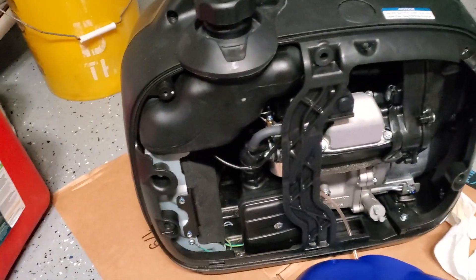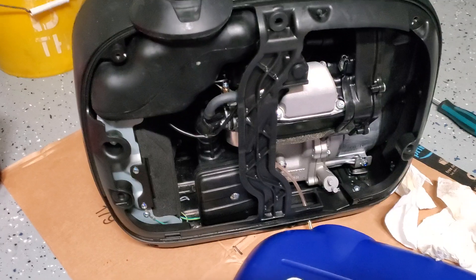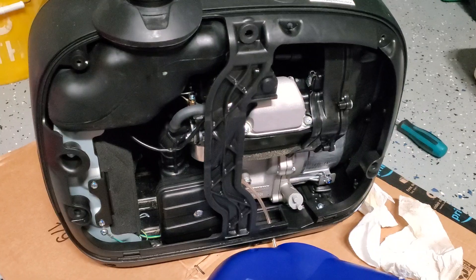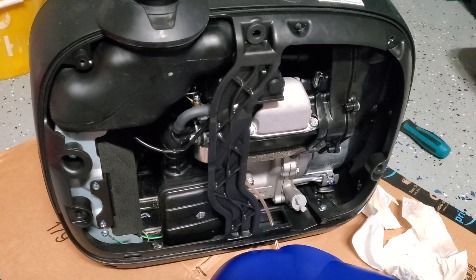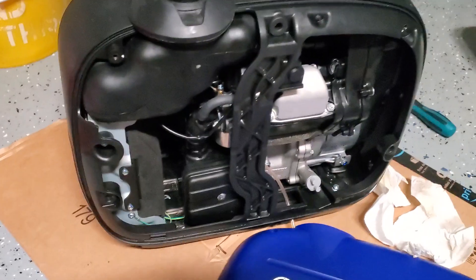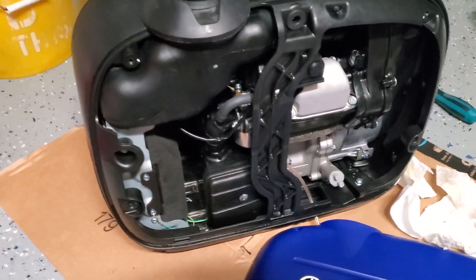So what I ran into this time: I shut the fuel off on one and it ran fine when I started up this week — I put new gas in it, the gas was two years old and it ran fine. The other one was surging and acting up and wouldn't start well. So I started to rip into the carburetor right before Milton shows up, and here I am doing work on these things.